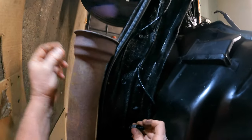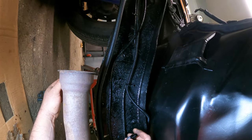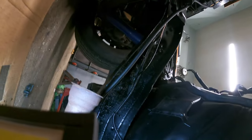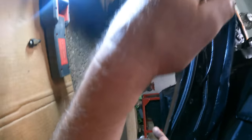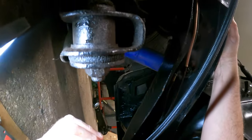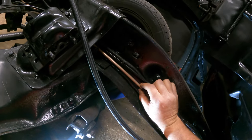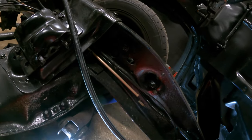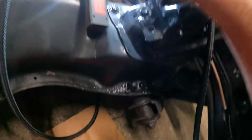Now I'm just going to get the right fitting. It'll go in there like that, and then it'll go to 6AN return line. Hopefully they make a quarter-inch 6AN fitting — I'll go inside right now and look that up. Let's see if I can get out of here, and then maybe I can cut that line to where I think I'll need it. Don't let me forget to hook that up too. I got to connect those two together still — which is pollution control. And as you can see, they're different sizes as well, but whatever, it'll be fine.